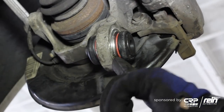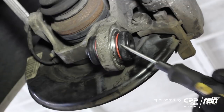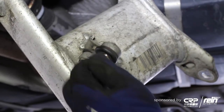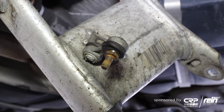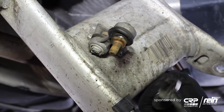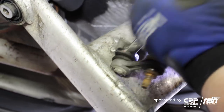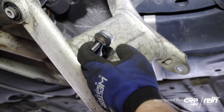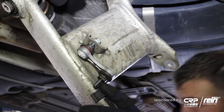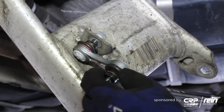You could use a pair of snap ring pliers, but because there's no hole to get the snap ring plier into you need a very specific set. Just use a screwdriver and keep pushing it in around as you go — eventually you'll see it seat itself. The sway bar links are okay but we'll replace them anyway since we have easy access. Same thing at the top — 16 millimeter box wrench on the flat spot, there's a little gap in the swing arm where you can latch onto it. If you have a question about orientation, double check the other side — you can see the flat spots easily right there.